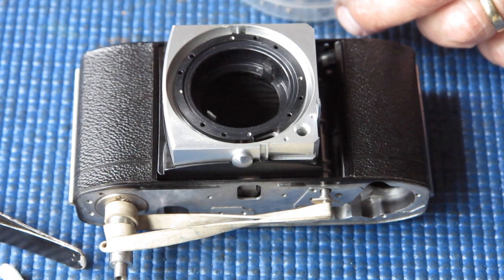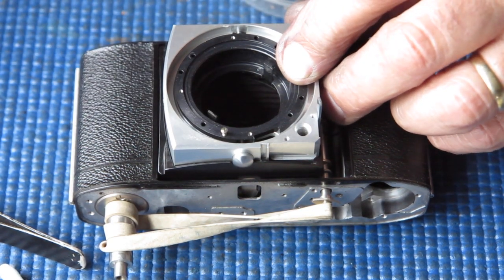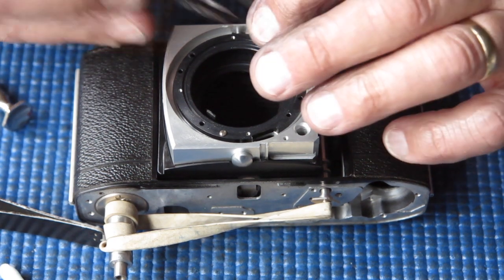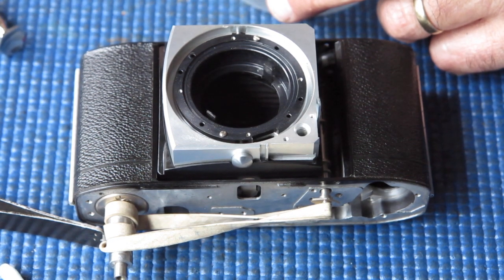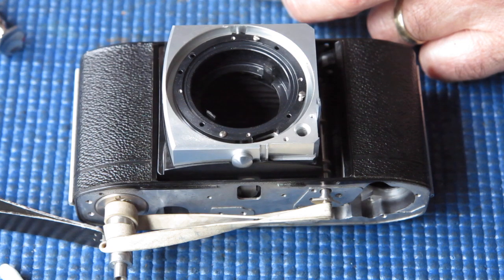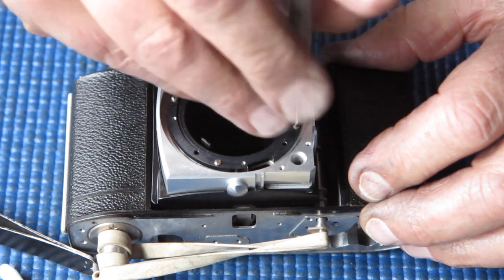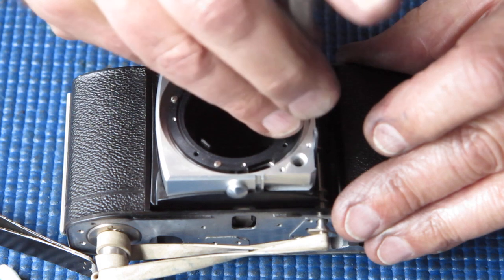Here's our focus mount. It's held in place here with four nickel-plated round head screws. Let's run these down lightly. When you've got all four in position, then you can tighten them up. If you just put one in position and tighten it up, you can be rest assured that the others will be a fight. There are four screws in position — now I can go around and tighten them. Just nip them up — these are only small screws, you don't need to go crazy.